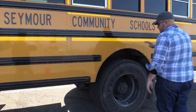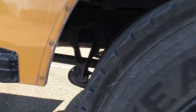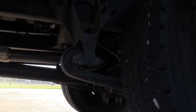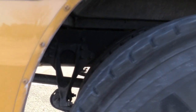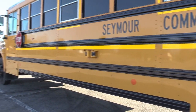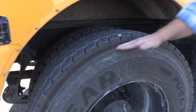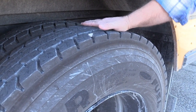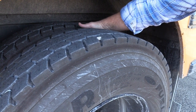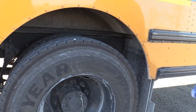Now towards the back of the bus, I'm going to check my springs and spring mounts, my U-bolts, my shocks, my axles and axle seals, my mud flaps, my air brake chambers, lines and hoses, my brake pads and rotors, and rims and lug nuts — all checked the same as the front. For the rear tires, I would check to make sure I have at least 2/32nds worth of tread, the recaps are not separating, and I have no tears, rips, or bulges. I'll check the space between the tires to make sure they are evenly spaced, free of debris, and not touching. I'll check proper inflation through the inner and outer valve stem and cap.